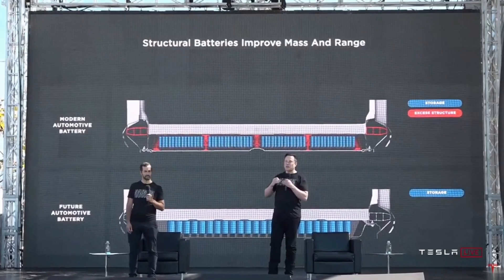Instead of having just a filler that is flame retardant — which is currently what's in the Model 3 and Y battery packs — we have a filler that is a structural adhesive as well as flame retardant. It effectively glues the cells to the top and bottom sheet, allowing shear transfer between the upper and lower sheet. Just like a Formula 1 craft or a racing boat with carbon fiber face sheets and aluminum honeycomb between them — this gives you incredible stiffness. Any super fast thing works by creating a honeycomb sandwich with two face sheets. This is actually even better than what aircraft do.